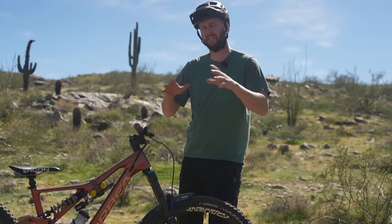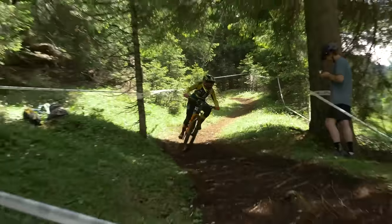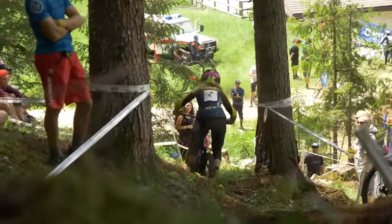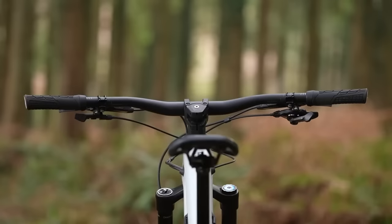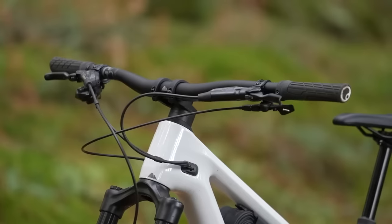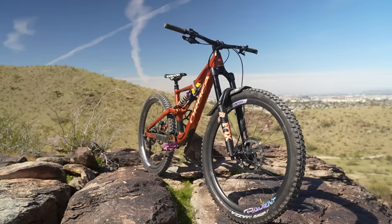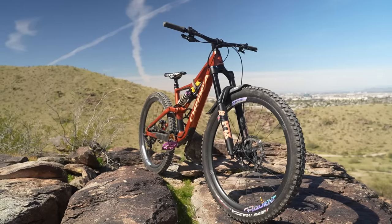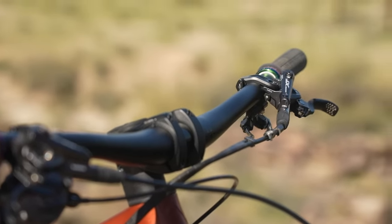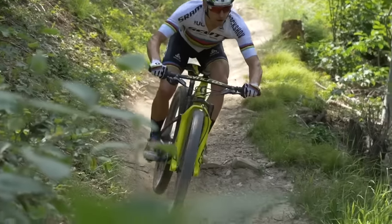That kind of width is maybe a little bit on the wide side for enduro. Wider bars are also going to change your stance, your body position on the bike — they're going to open you up, bring out those shoulders and elbows much wider. This is good when it's flat out, but we don't want to be like this when it's real tech. We want to come in a little. 740 to 760mm is the go-to range. I run 760s pretty much across all of my bikes, and I know a lot of pros do the same.